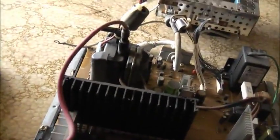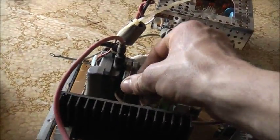It's got a signal plus and a signal minus — it's definitely a DC output on that. It's an LG flyback, actually. It's a bit of a tricky spot to put a primary coil on, because I'm not designing these for ZVS drivers. I'll have to move that ferrite coil and Dremel down all that plastic to get the new primary to fit.